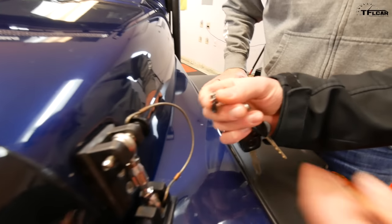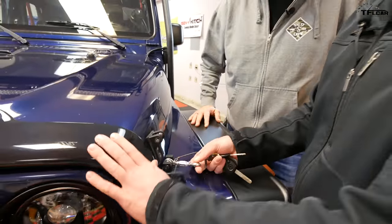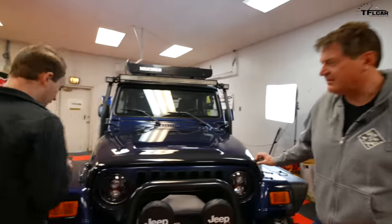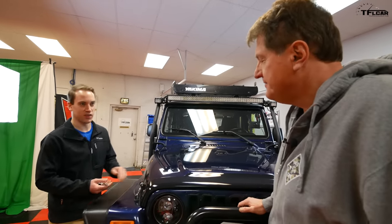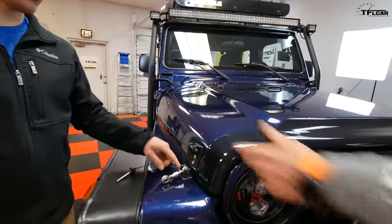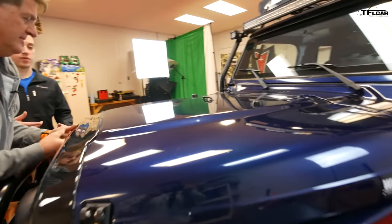How much were the Drake latches and how hard were they to install? Not too hard — but kind of hard if you have a TJ with rust. The hardware at least rusted on this car, so the bottom bolts were difficult to get out. But once they were off, it's a piece of cake to get open. You still have the same interior hook that pulls back. The 2000 model goes sideways, but 2003 is when they started changing up a lot of things on the TJ.